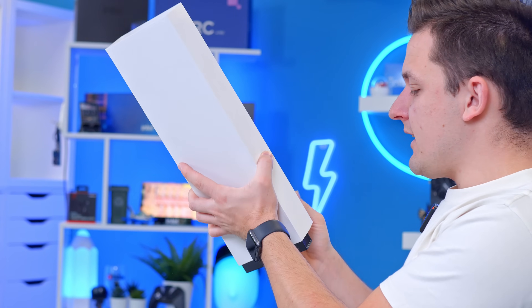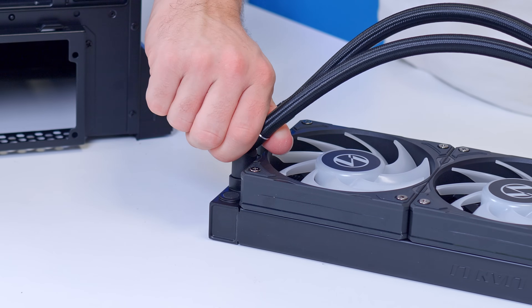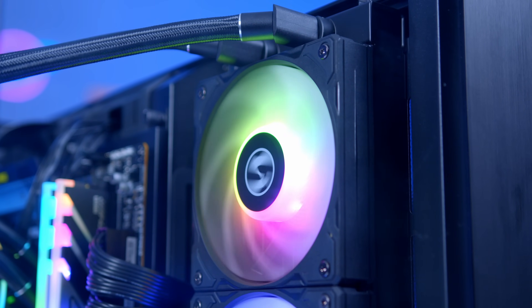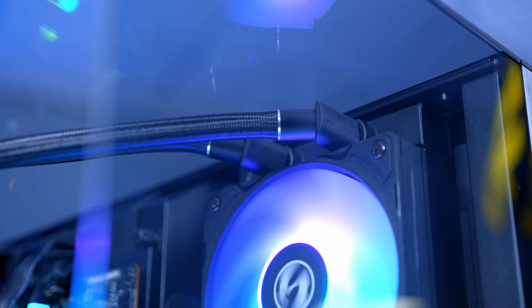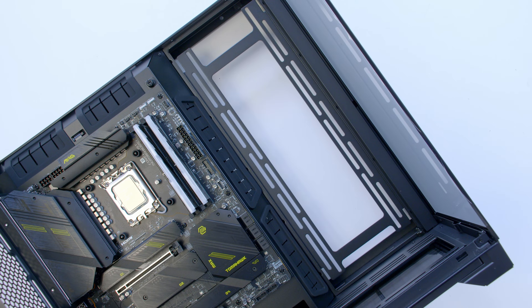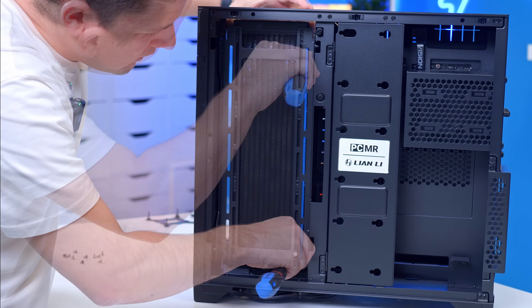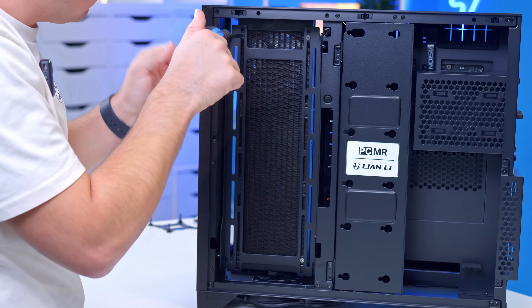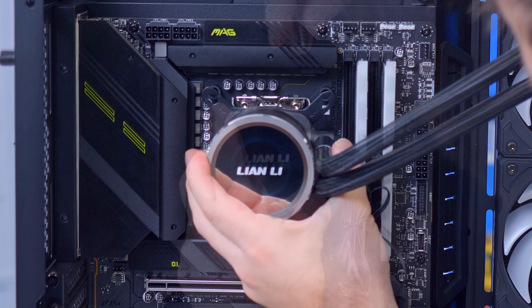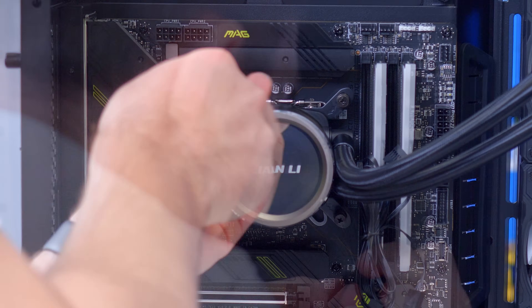The next step is the radiator. What I like about this new Galahad 2 Trinity is first that the fans come pre-installed — that's a nice touch. But perhaps more interestingly, you actually have rotatable fittings between the radiator and the pump and water block. The idea behind this is it reduces cable fraying or allows you to more easily move the tubes in the direction that suits your build, and aesthetically it looks a lot nicer and makes tube management a bit easier. I'm going to pop this on the side of the case in exhaust and then use the bottom of the case for intake. I need to stand the case upright and screw the radiator in from the back. Secure the radiator in and then it's a simple case of popping the water block on top — no pre-applied thermal paste, so you need to do that yourself. A large grain of rice roughly as a size guide is what I go for in pretty much all of my builds.